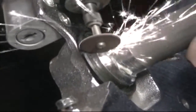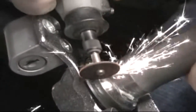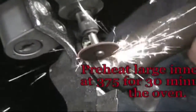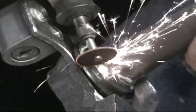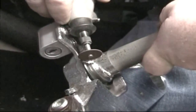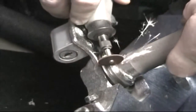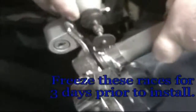I'm going to heat the inner races to about 375 degrees for a half hour. So this will be your bigger bearing inner race. The heating them up is a maintenance trick we use in my trade — they don't just drop on, but they sure do go on a lot easier. And we've got the outer races that go in the neck already in the deep freeze to shrink them down a tad.